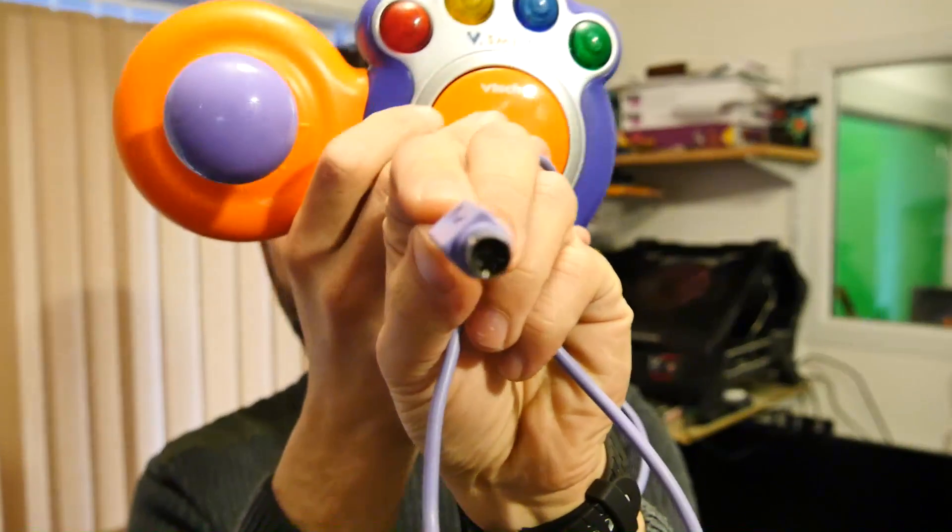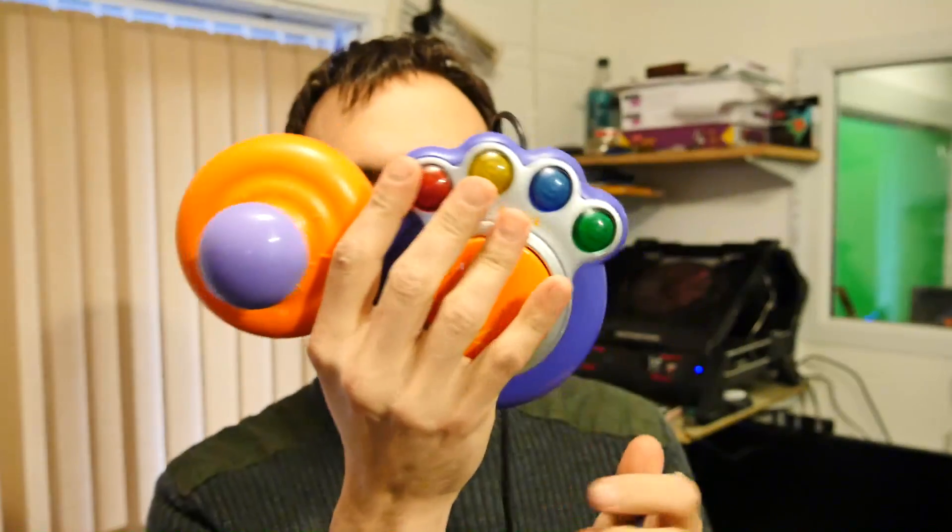So what I'm going to do - I've seen two minds about this because it's got the USB cable I can use on any PC - but on the other hand it's not stock, so I'm going to fit this PS2 adapter that it came with, the original plug that the VTech uses, back on it, and wire that internally into the USB bus for the Raspberry Pi, and then get a second controller and do the same fix on that. So I'll basically have a dual player arcade system, and any additional players can connect via Bluetooth controllers.